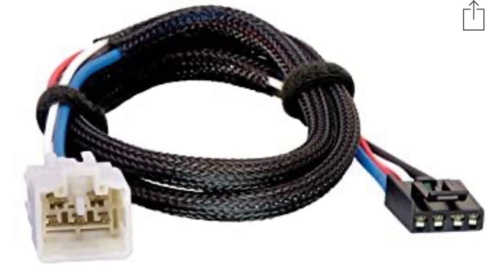I really like it there because it's easy to see, it's in my line of sight, and I can reach over quickly to make an additional braking maneuver if needed. This truck did not come with the factory wiring harness — typically you find those in the glove box on a new vehicle. This was a used vehicle, so the gentleman may have thrown it away. A simple solution was going on Amazon and finding a direct connect between the Tacoma and the Tekonsha Prodigy P3. I didn't even have to do any wiring — just plug it into the truck and plug it in here.